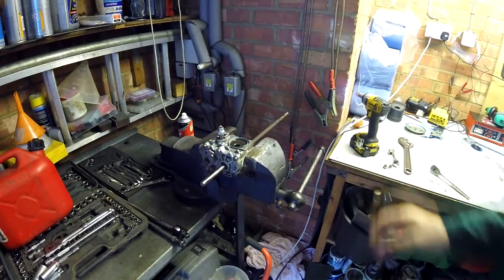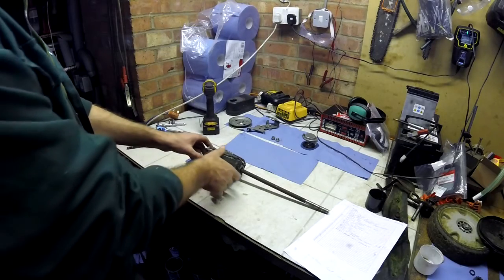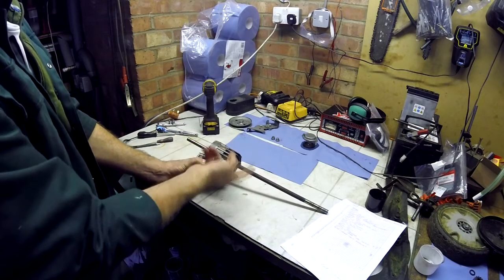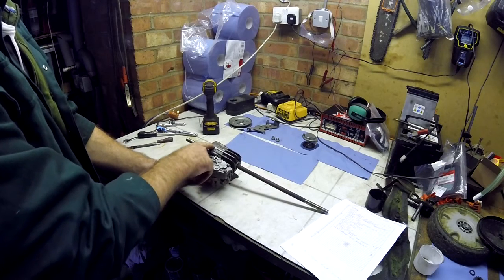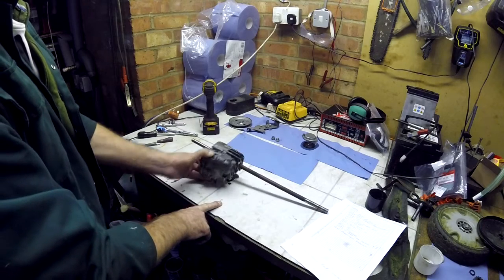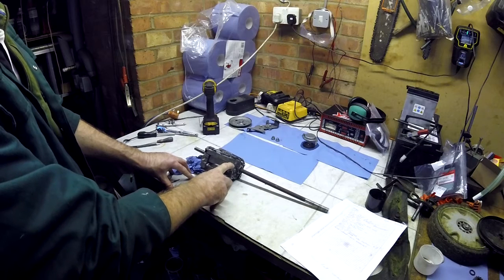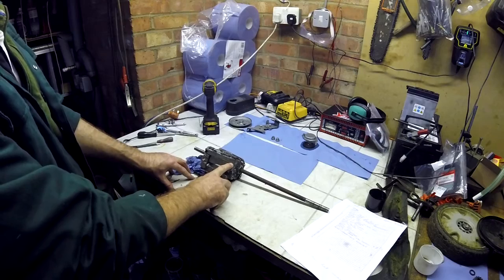When you look at the state of the oil, you can see that it looks a little bit metallic and certainly really dirty. The oil's out. A couple of bits of advice. When this shaft comes out eventually, it can actually fit either way, so it's worth just making a note which way around it goes. I put a little S on there with a scratch and an arrow, so now this is the short side when I put it back together. The other thing to be really careful of is, as far as I'm aware, you can't get gaskets, so if you can, try and protect them. If not, you'll end up having to make your own.